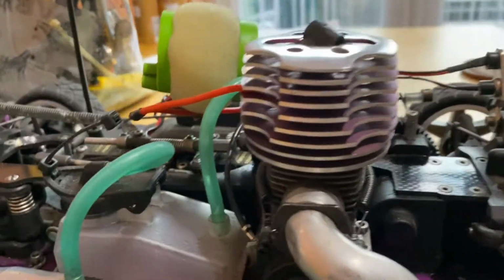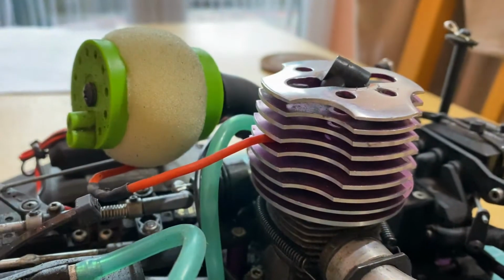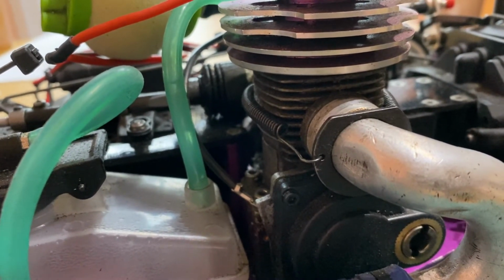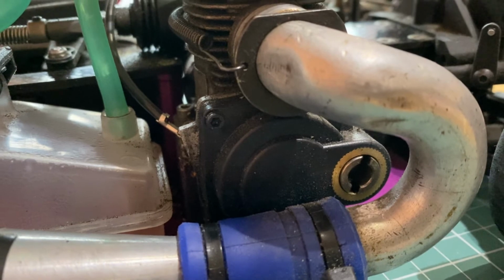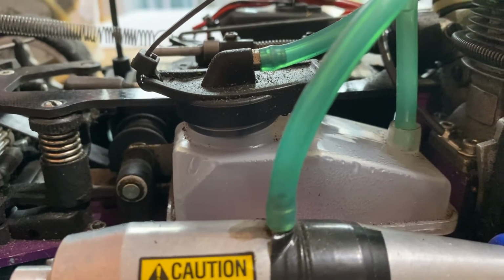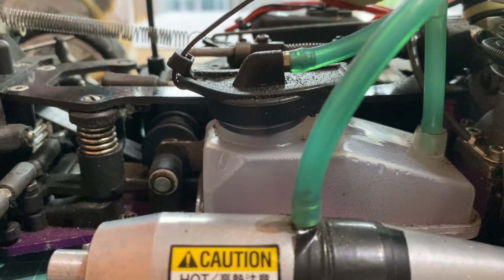But yeah, very reliable. Started first time. Found a bit of a knack to starting it up, if I'm honest. Rather than pumping the fuel through using the spindle there and the roto start, I just removed that pipe, and going back to my Rotax Max days, you had to pressurise the fuel tank. So it's probably a normal thing that everyone knows. I wasn't aware of that.